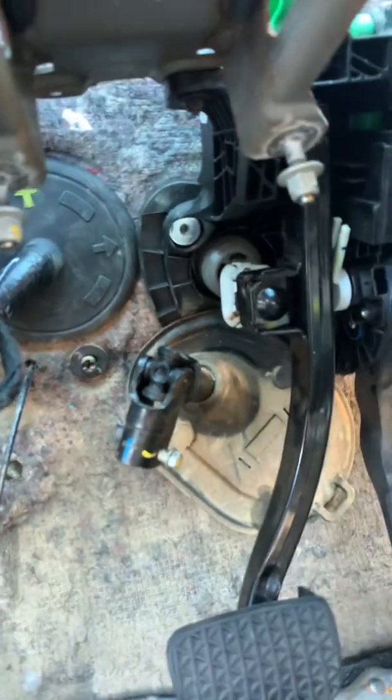I ran it off in the front to where I took it off. The reason I had the bumper removed is because these three connectors go to the harness that runs in there. You actually have to take the whole bumper off because you have this harness that runs in here — just a couple of connections, but you wouldn't be able to take off the little clips connected to the body unless you removed the bumper.